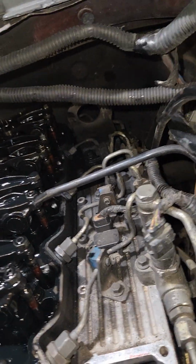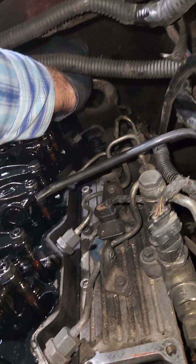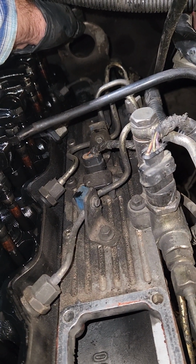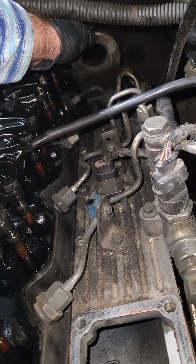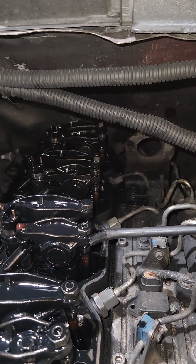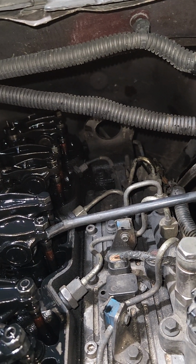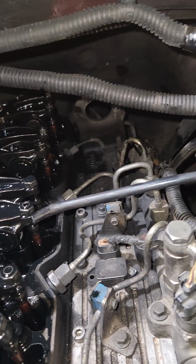This one in the back, you will have to pull the 2 bolts, the ones that hold that lifting ear on right there. Mine are always just pretty much finger tight because I've had to do this so many times. My lifting lug is also bent in, so it makes it a pain to get a wrench on there. I never have straightened that out, but it's from pulling the engine, yanked it over. The one on the back is a pain, and you have to have that out to get to everything anyway. Typically I pull the number 5 injector line, and then I've got enough room to get to it and get that pulled off.